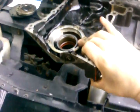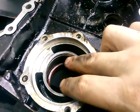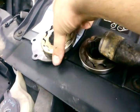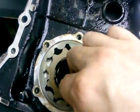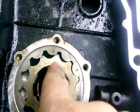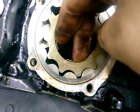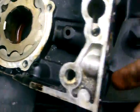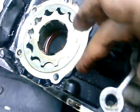This is a bad housing — you can see where it's chewed up right in here. There are normally gears, but these are both bad sets. As the oil is pulled in through this passageway, it cycles around, compresses, and then pushes out through this hole here, bringing it in, cycling it around, compressing it, and pushing it out.